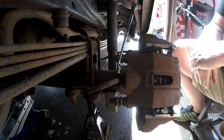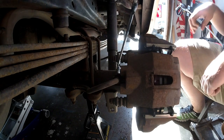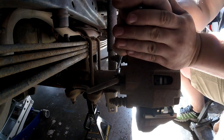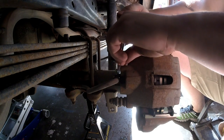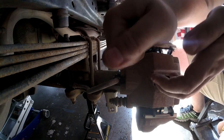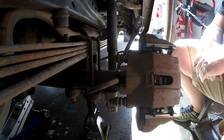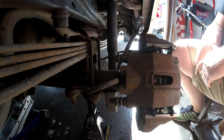Go ahead and pump. Let me know when you've got four pumps and hold them. He's at the bottom again. Pump. Does that feel pretty good? I didn't have hardly any air that time, so I'm going to jump to the other side.